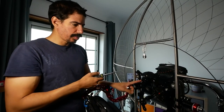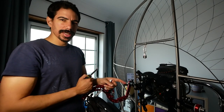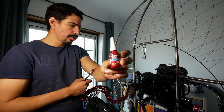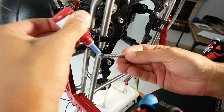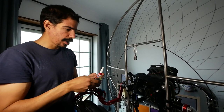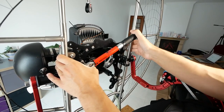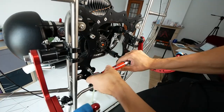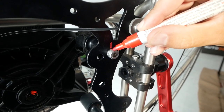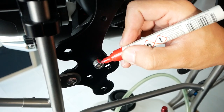These are just tight-fitted in place and not torqued yet, just to make sure everything fits and we're in the right holes. Even though it doesn't say so in the manual, just for peace of mind I'm going to use Loctite 243 Medium — the blue one — on these bolts, because these are the only four bolts holding the motor in place. I'm going to fit them on and then, once they're almost there, torque them. This marker line is so that we can tell if they're loosening — put the mark somewhere easier to see.